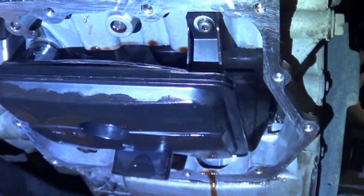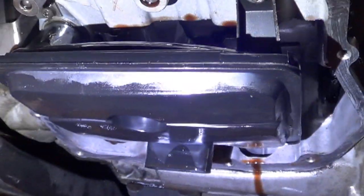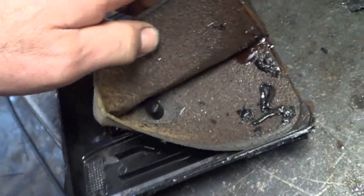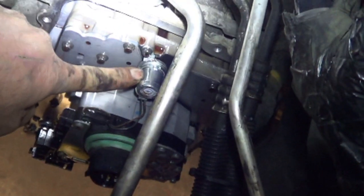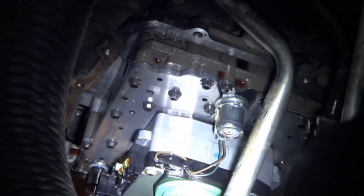Whenever you do a repair like this, remove the pan to make sure there isn't a significant amount of metal. We've already pulled the pan and changed the filter — this is the new filter. Break open the old filter because they're very good at trapping components; check for metal contamination. There was no significant metal in this one, and there's some silicone inside — obviously someone had a messy transmission service before. So I think we're good to repair this with just the solenoid. We had to remove bolts from a bracket on the AC line to get flex and room to get the cover off. Here is the solenoid — it's a simple matter of removing that bolt and unplugging it. It's changeable by itself; you don't have to change the whole solenoid pack.